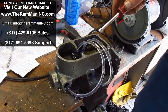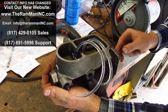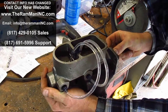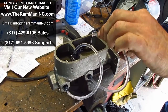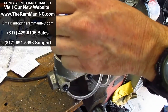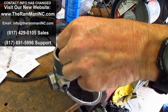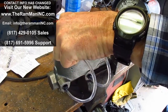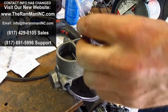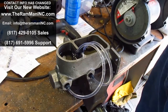We're going to check and make sure that this master cylinder bleeds correctly and releases. Got really good fluid flow. These snout master cylinders with this extended stroke typically work very well. It's obviously released and draining back — this master cylinder is functioning correctly and releasing correctly.